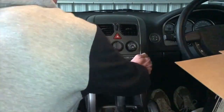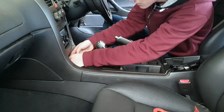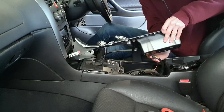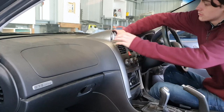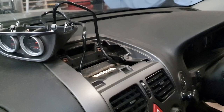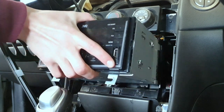If your car still has a stock head unit, push the pins into the head unit and remove it. Then remove all the plastic surrounding the head unit — same as with a non-stock unit. Start by removing the tiny screw under the pocket. Make sure your handbrake is on because you'll need to take the car out of park. Pull up the centre console plastic and pop out the clips. Remove the rubber pocket piece, unclip the window controls, and put this piece aside. Remove the two screws at the top panel, pop that off, then remove the four screws in the next piece. Unplug the hazard lights if you can remove the piece fully, otherwise hang it to the side. Remove any fasteners from your old aftermarket head unit and slide it out.